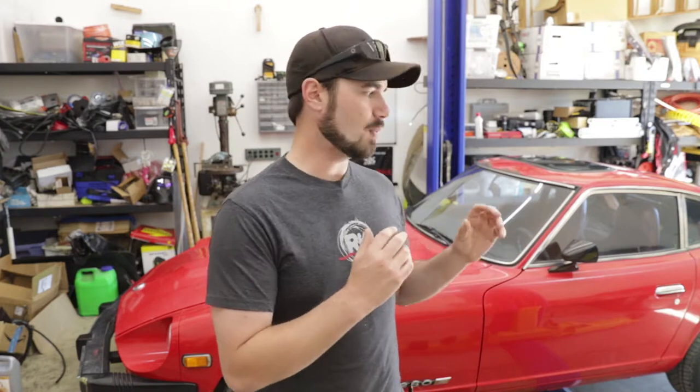While we were in there, I found that the rear drum brakes had been semi-functional — one was completely leaking fluid and the other seemed to have been stuck, so it wasn't fully engaging. While I was at it, I ran down to the parts store, grabbed some new wheel cylinders, and replaced those while doing the rear shocks. Now the rear end has the same KYB shocks, stainless braided brake lines, and new wheel cylinders inside the drums.